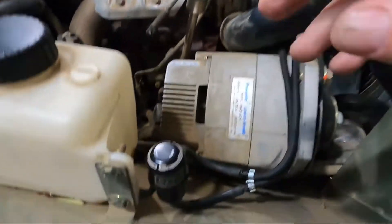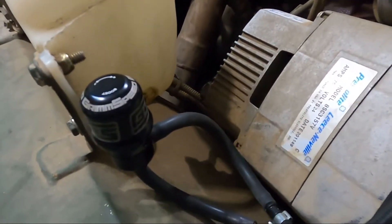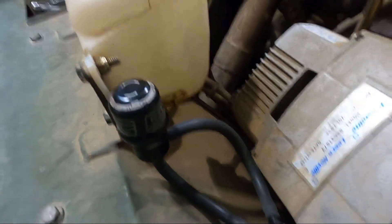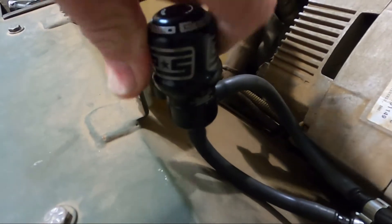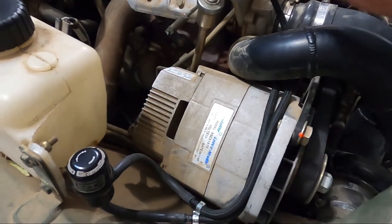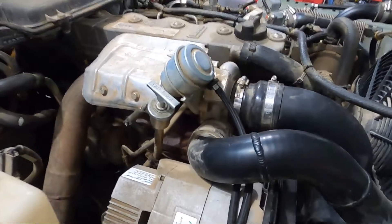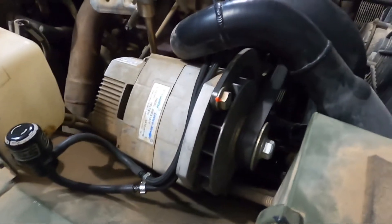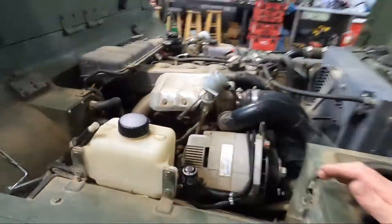To remedy my problem I bought a boost controller — this one is GrimSpeed. There were a lot of crummy Chinese ones online. There's one that looks like it might work really well that someone makes in their garage out of brass fittings with a check ball and spring. This one was about a hundred dollars and it's adjustable — you can hear it click and it's got a gauge so you can see where you have it set. What this valve does is limit the amount of boost that goes to my wastegate valve so I can set it where I want. I hooked this up, got rid of my smoking, have a lot more power, and I can really hear the turbo working.